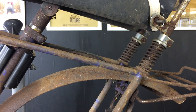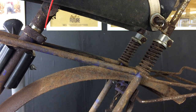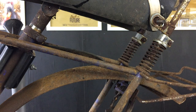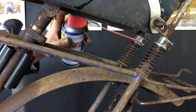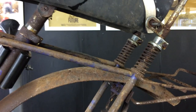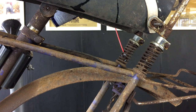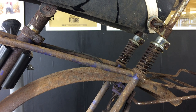I think I'm going to call it there for now. I'm just going to try and lubricate some of these bolts a bit more. I think it's probably best to take time and wait rather than force some of these parts and break anymore. Just a bit down in the frame — already I can see that it looks pretty welded in at the top of the frame, so it might be a case of cleaning it in situ and then lacquer painting it.